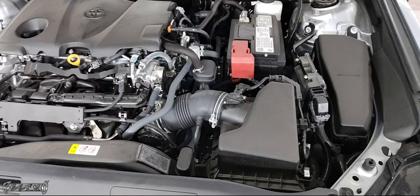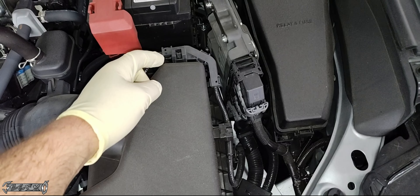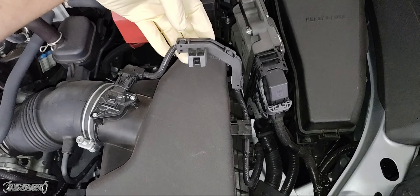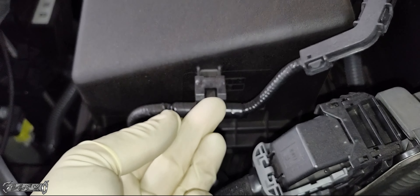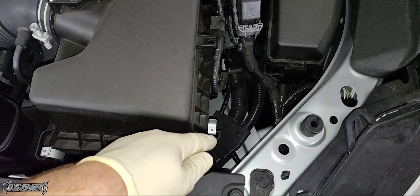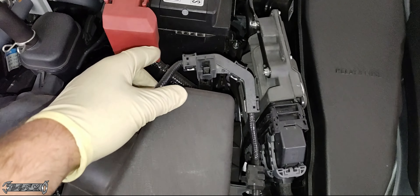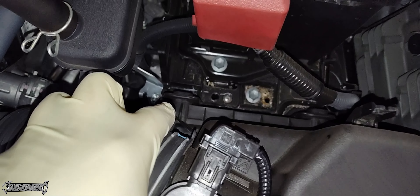With the 2.5 liter, come over here where the air filter is. First, get this wire harness off — there's a little tab right here. If you just gently push it forward, you unlock the connector and slide it right off. It's really easy, shouldn't be hard at all. Then this becomes loose, and these thumb clamps you just push them off.